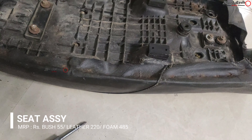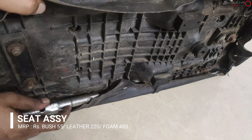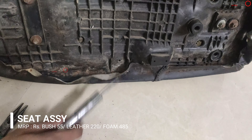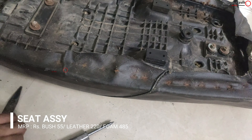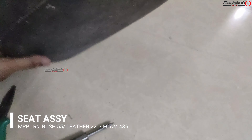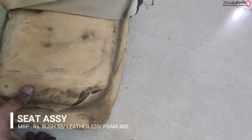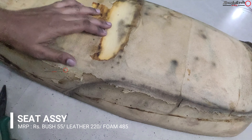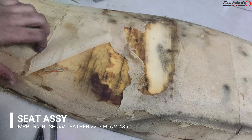This is a plastic seat covered with staples all around it. For some other models like the Royal Enfield or old RX 100, the seat comes with a metal part where you have to stick with glue and cover it with split pins and beadings. In this case it is a normal seat assembly — the outer part is the seat cover, inside is the foam, then the frame, and it is stapled all around with bushes at all corners with the bracket assembly.